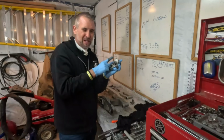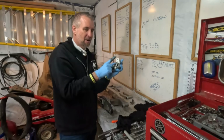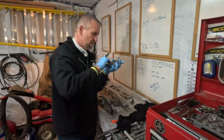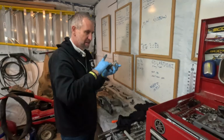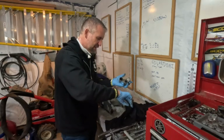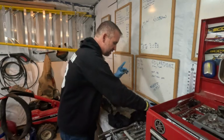Make sure you're twisting the needles to turn them, so that way they get grease on all the sides. They're kind of falling out as I turn them, but that's okay, everything's greasy, and I can put them right back in. See, there's one of the needles. Just plop it right back in, all nice and greasy. Okay, now with all that grease, we don't have to worry about the needles falling out. So then what I like to do is also grease my pin.